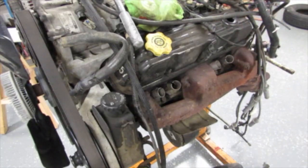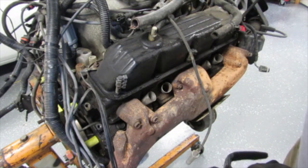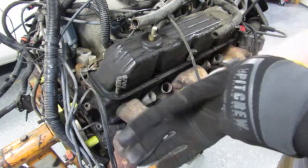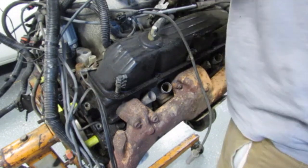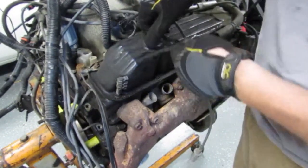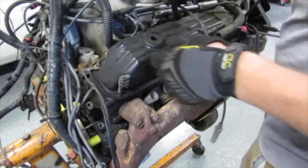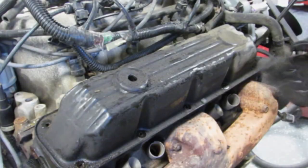That side was the worst. Let me go around. I'm gonna pull this side's valve cover real quick and try to check back here. That PCV is over those two. I don't know, probably doesn't have anything to do with its issue, but maybe. You know, that could be a part that they neglected to ever replace. Got a nice rattle to it. I'm gonna vacuum this out and pull that valve cover.